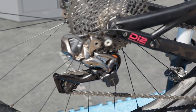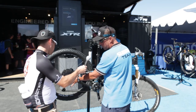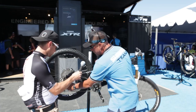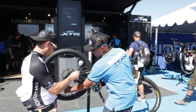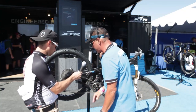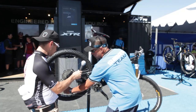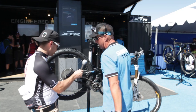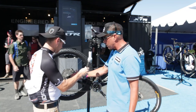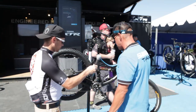It is Shadow Plus, so it's as narrow as any current-generation Shimano Shadow derailleur. It is also Plus, meaning it has the built-in clutch — you can see that here. In the open position for taking the wheel out of the dropout, you have chain slap like everybody used to. Go into clutch mode and now it's much tighter — you could hardly get the wheel out of the dropout in that manner. It's e-tube wiring, like all current Shimano Di2 systems: plug and play, very easy to put together.